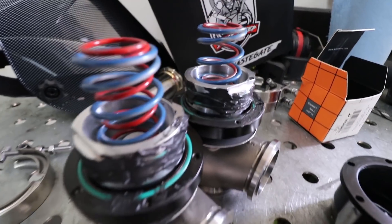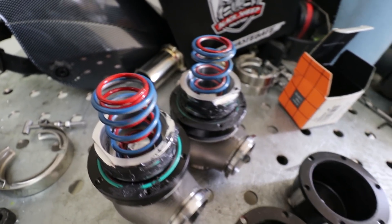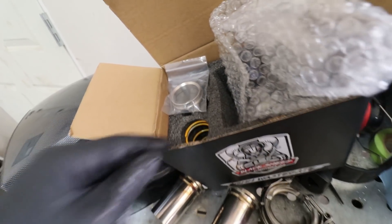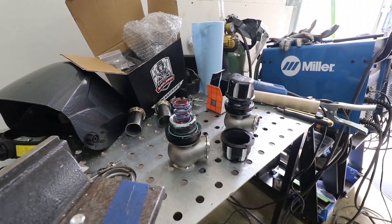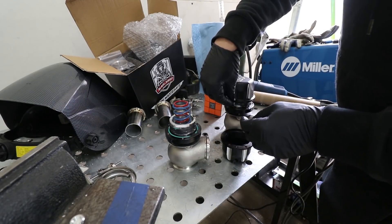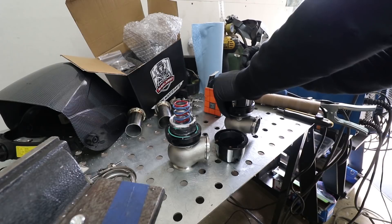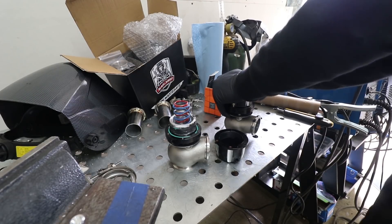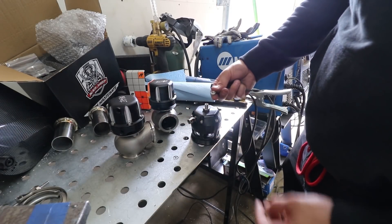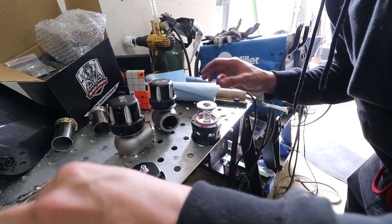There we go — all lubed up. Kind of messy but it's all on the inside. And then 12 pounds of spring on the inside as well. This one roughly 14 — it all depends on your cubic inches and your back pressure. This is roughly 12 pounds. Just to show you how easy it is to push down: once we have this in place, normally a 12-pound spring, like a one bar spring on another wastegate, would be super hard to push down. This one you just gently push down. If memory serves me correctly, this little nipple-type thing belongs right underneath that screw, and this thing actually screws on top of this. So that, then this. Yeah, this piece goes in there.